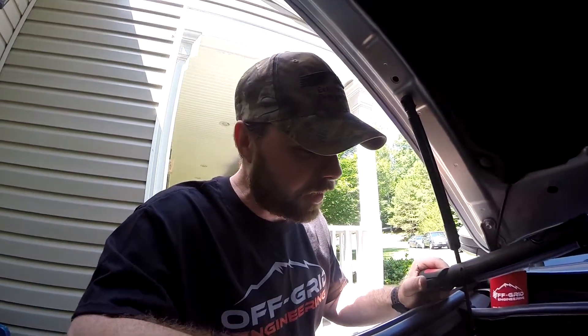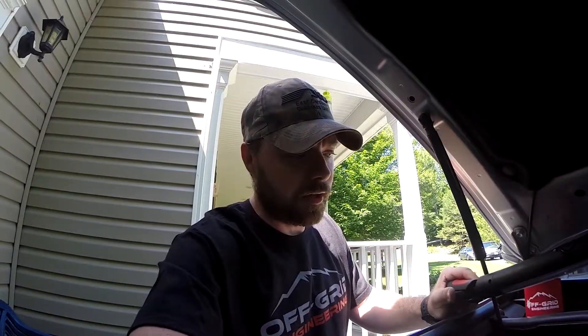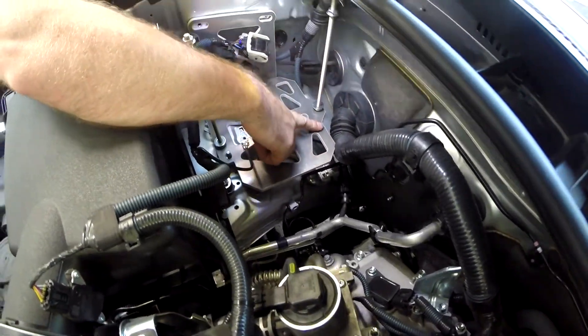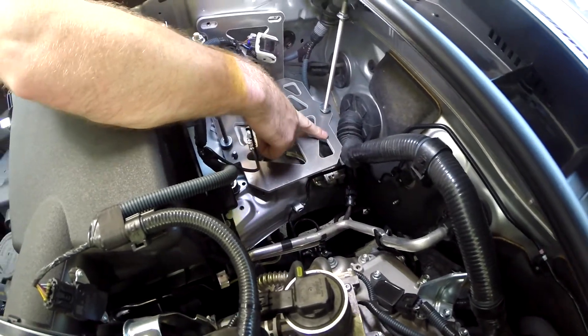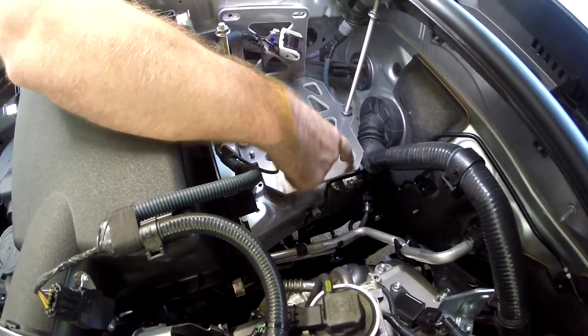This aluminum rubbing up against the painted steel — we're not really confident that's going to hold up long term. The other thing is we have a section of the battery tray that's rubbing up against a major boot that's bringing a wiring harness into the vehicle. We're a little worried about that abrading over time, so we've got a couple of ideas about that and we're going to give some feedback to Matt to see if he has any ideas he may want to address.